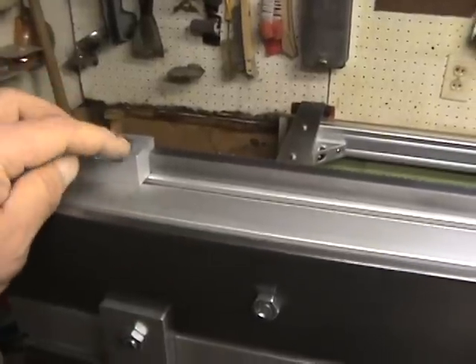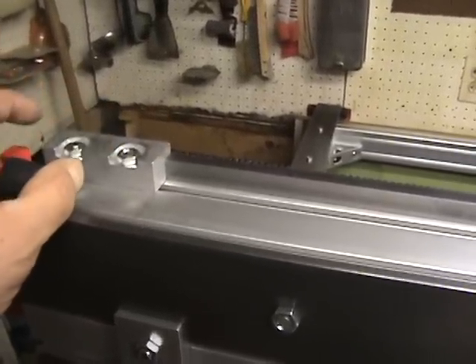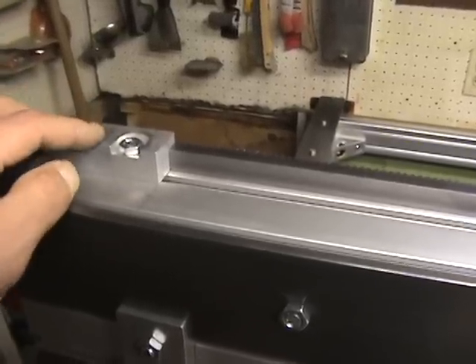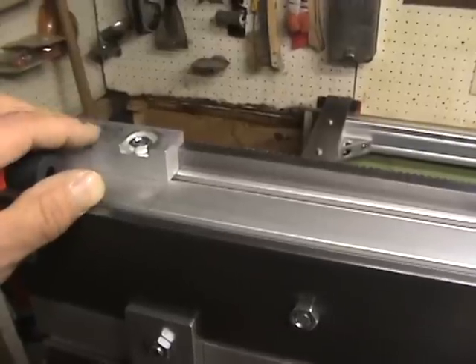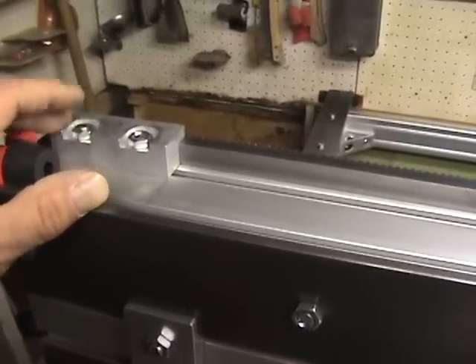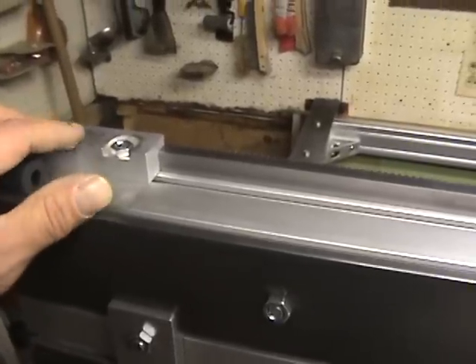So what I did was took an Allen wrench or something to push the bolt up so I could get a couple threads started. After you get the thread started, what you might want to do — and what I did — was take a brass hammer and give it a good wrap on both sides and in the center to seat it in a little bit. Prior to that, I tried to torque this down with just a partial thread on here, and I literally stripped this one thread out, so I had to replace that bolt.